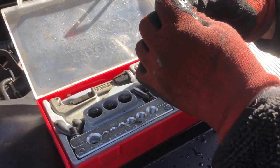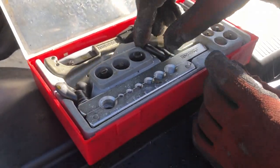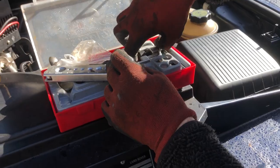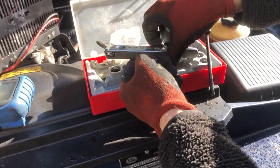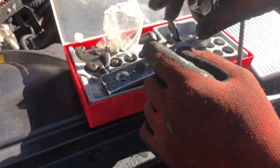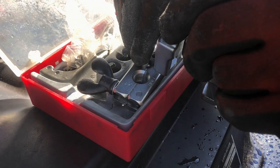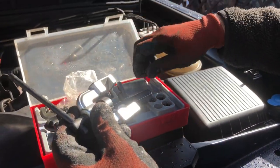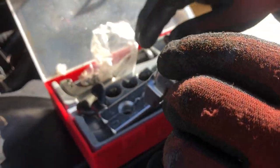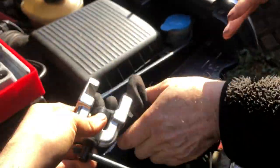We'll tell you what flares we did in case you're thinking of buying this stuff to do it yourself. We've got a video about this. We used the 3/16 inch - 4.75mm - and you do the normal bubble flare with your tool. So you have your brake pipe coming through that 4.75mm die on this vehicle, you place that in the brake pipe and squish it down, then leave it in there and come back on top of it just with the pointed part.